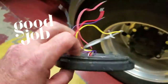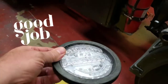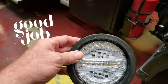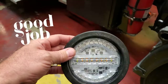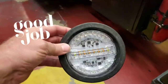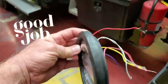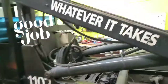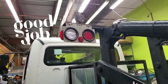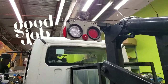Welcome back to Flash Equipment. We've got an installation here today — the all-new stop, turn, tail with backup and strobe built into it, a combination light. This is the four-inch round grommet mount. It's also available in an oval, and you can surface mount these, but in this case we did the grommet mount. It's a pretty nice install because you've got the existing brake lights — we pulled one out, tapped this in, and we'll turn it on right now.